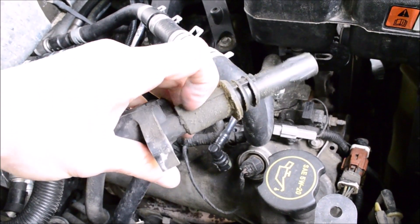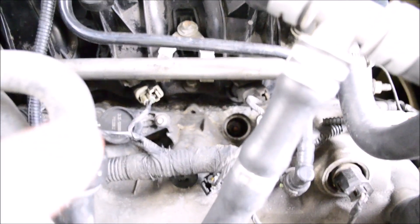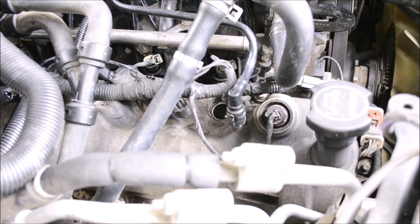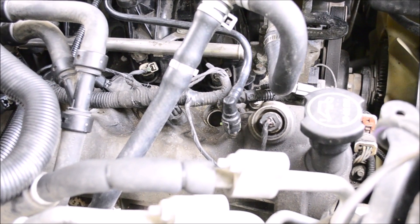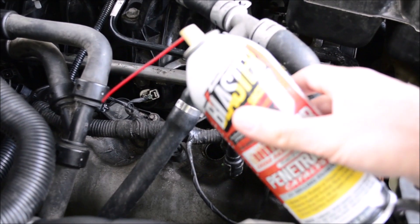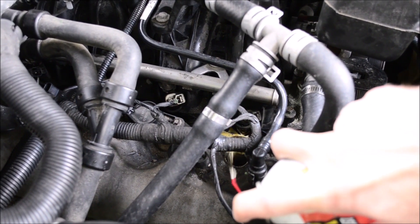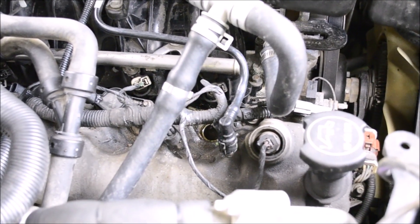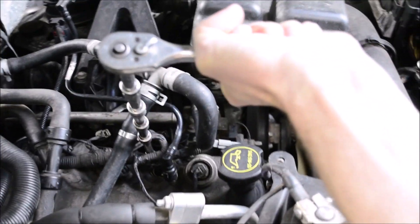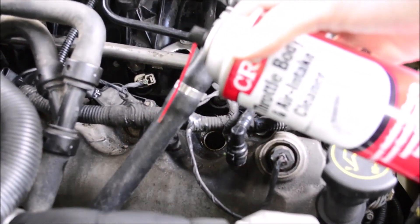If they do break, you can replace this portion that pops off. Once you remove that coil pack, use that compressed air and blow out that spark plug hole one more time. Make sure there's no debris in there. And now the most important step — follow this carefully before you attempt to remove the spark plug. Spray that penetrating oil into the spark plug hole and let that sit for 15 to 20 minutes. Then turn the spark plug out one quarter turn — don't go any further than that. Then spray in the throttle body cleaner.